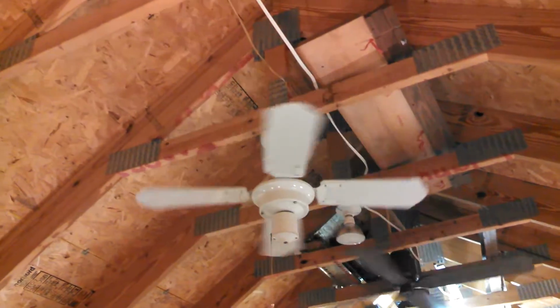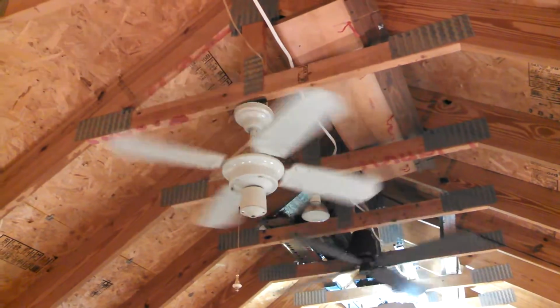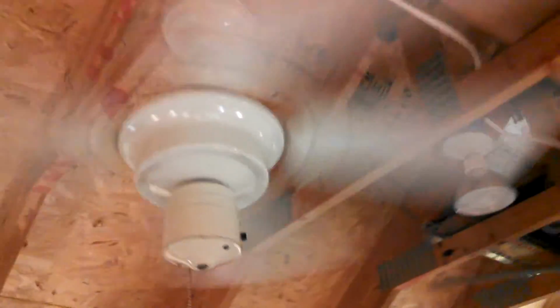Okay, low with the 4-speed. 0.27. I cannot remember what low was with the pull chain and forward. Too many things have happened since then. But it appears to be a little slower here. It's not a bad low speed for a 36-inch fan with a standard wall control. Medium low. 0.6. Wow, quite a jump. Medium high, 0.85. Is that a resonant frequency? Yes, it is. So this controls a no. But what I do want to do is turn it back to reverse and just see what it does in high reverse.